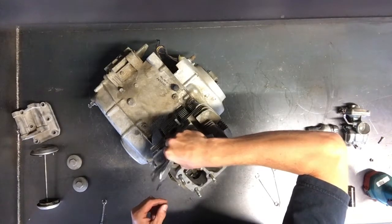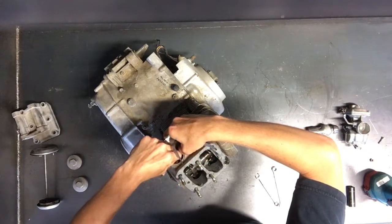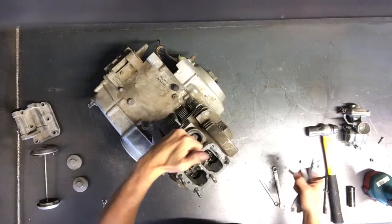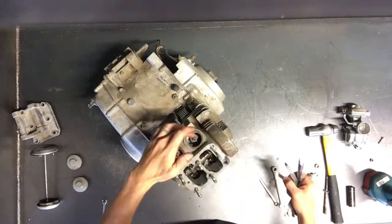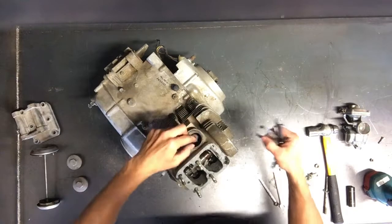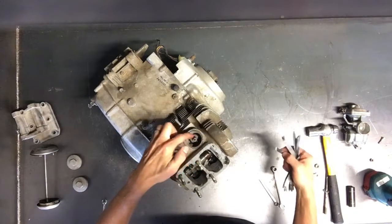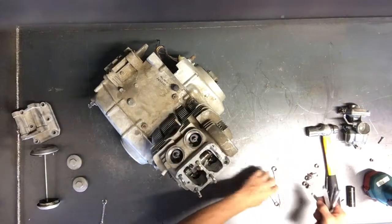If there's a little bit of drag, that's about where you want it. So you get it to where you want it, you tighten it up. After you loosen that 9mm nut, you can just spin the square head nut or little bolt there with your fingers, and then get it to where you want it, and then tighten up that lock nut and snug it up with a wrench.